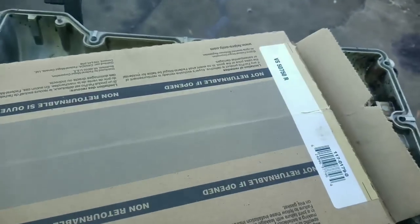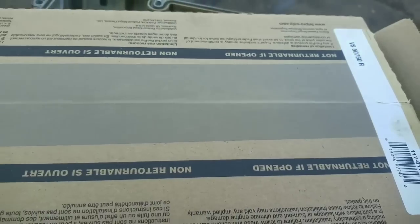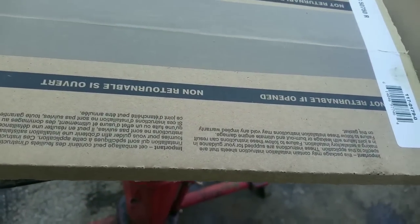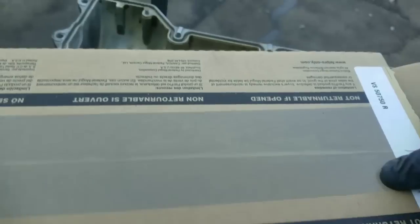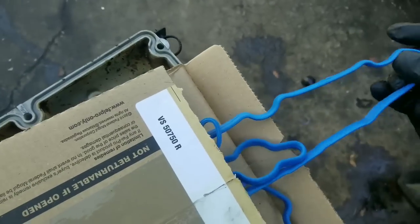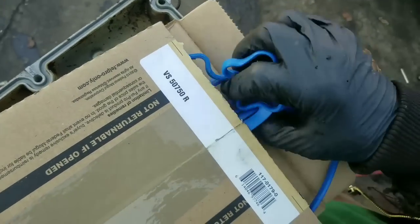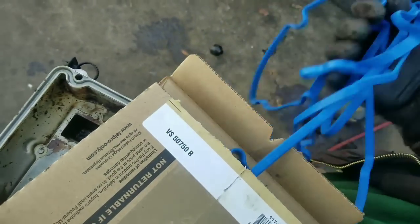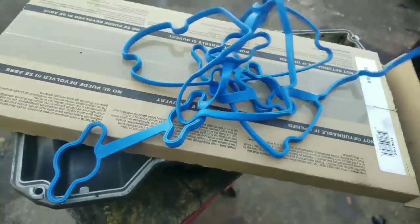See how close it is to that lid? If you slide that knife across through there like that, you run the risk of cutting that gasket in half. Then you've got to go back and buy another gasket and explain to the auto parts store guy what you did, and, you know, not the best moment of glory. So you'll notice your gasket. We got one for the front, one for the rear.